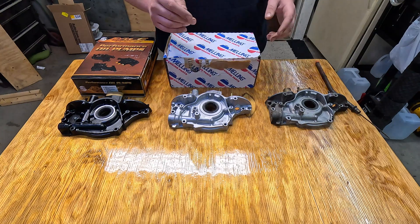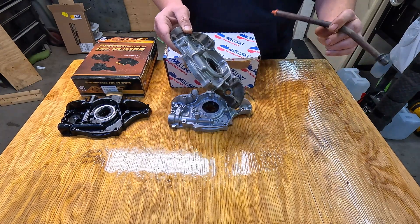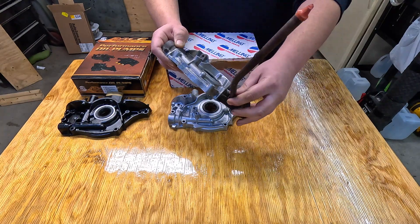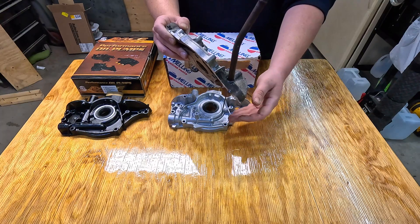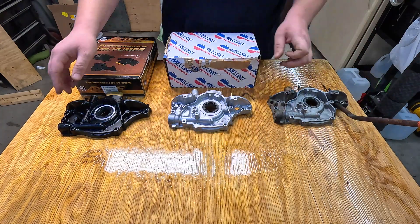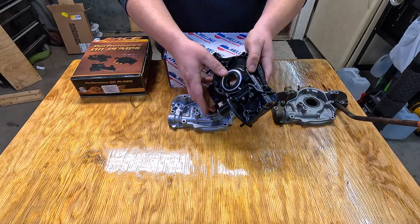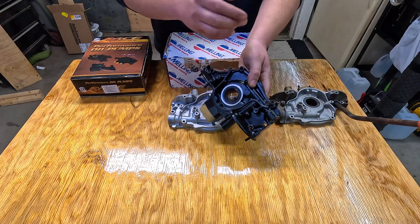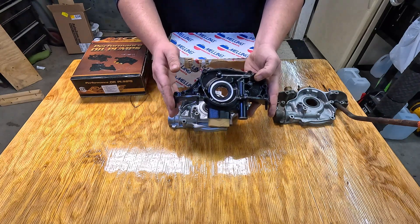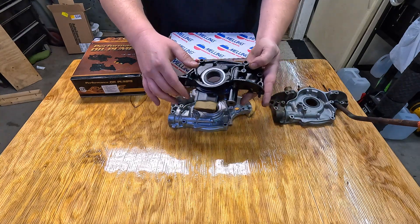The next issue you would run into is, as you can see on the Y8 pumps, there is an extra slot right here for a dipstick tube. So we've got the dipstick that came out of our parts engine here, and as you can see that goes right down in there, and then this part of the dipstick obviously would go to your oil pan — that's how you can check how much oil you have in the engine. So if you look at our Z6 from ACL over here, you will notice that there is no spot for a dipstick. On the Z6, the dipstick spot is actually molded into the block. So that is going to be a problem if you're trying to run a Z6 oil pump on a Y8 engine, but there are a couple ways to get around that.